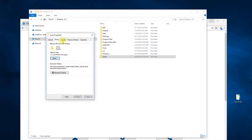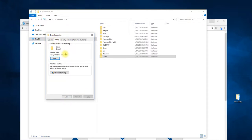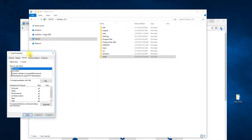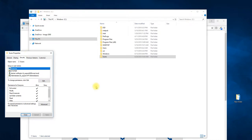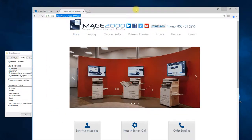Then we want to verify on the Security tab. Under the Security tab, we just want to make sure that the Everyone group we added is listed here as well and has full permissions to the folder. Once we're happy with that, everything's good to go. Now we're going to move on to the address book entry for the Sharp machine. For this part, you absolutely need to know the IP address of the copier. Once you know that, type the IP address of the MFP into a browser and you should be able to connect.